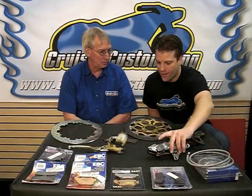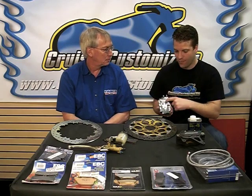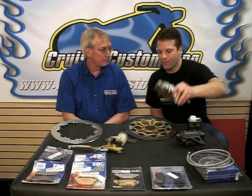Swapping out the brake pads is the most simple part of this process. You basically remove the pin, drop the pads out, put the new pads in, and replace the pin. Be it 1 pin or 2 pin, it's really a simple task. Now, probably the more scary part for most people is the bleeding of the brakes.